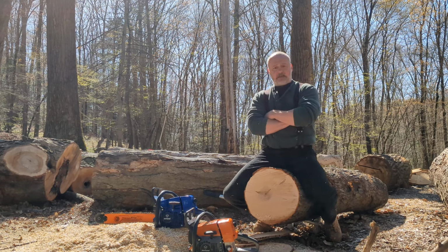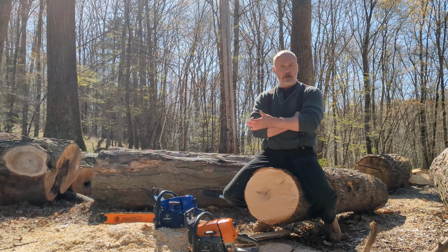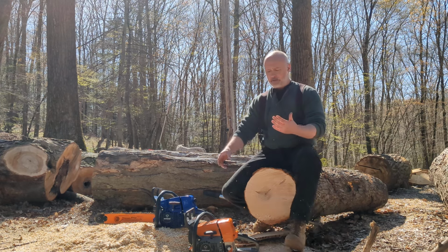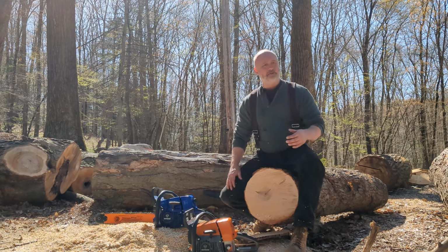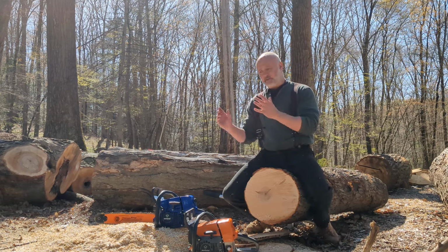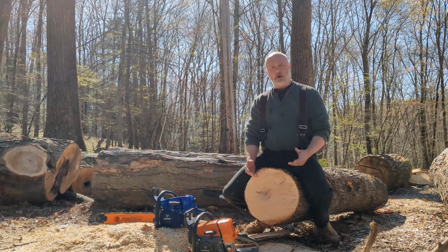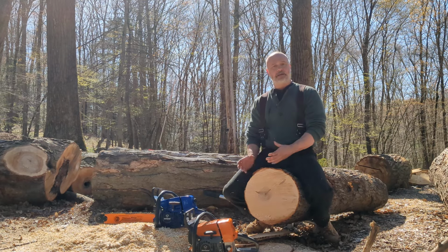That being said, we all know that the Farmertec 372 or any of the clone 372s with the HLIC, it's a problematic carb in that. And on these 366s, it's funny. I go through periods of time where I think that maybe it's straightened out, and then those carbs will start acting tweaky in a week or 2 weeks or whatever. So it's not a reliable carb in the 366. The simple fix is to swap over to a Walbro carb. You throw the Walbro carb on and it solves just about all your problems on a 366.